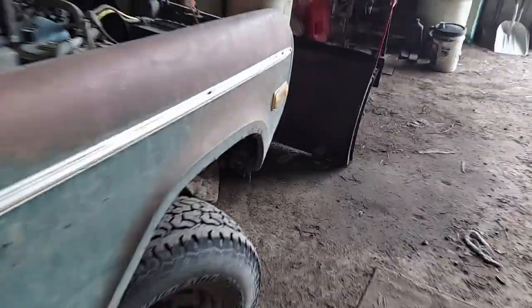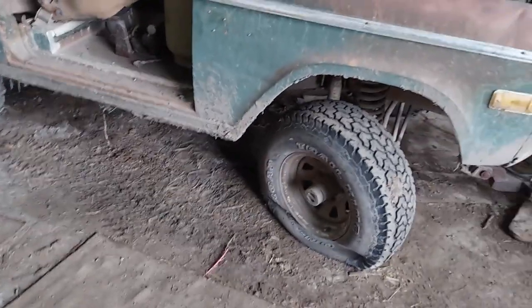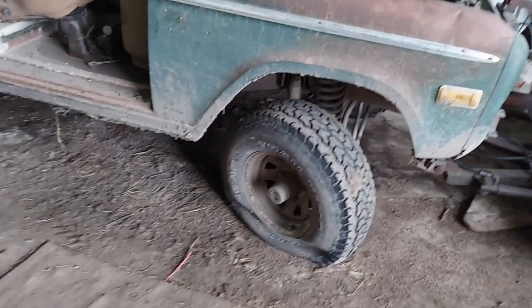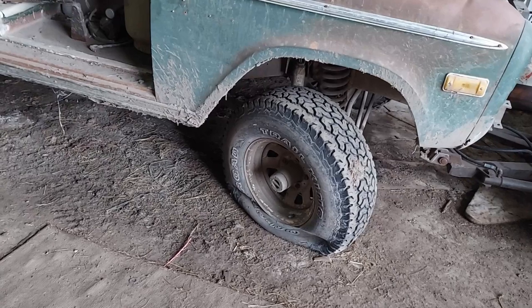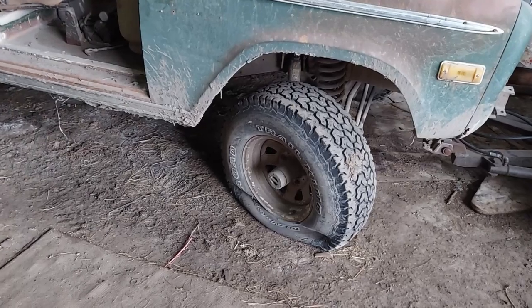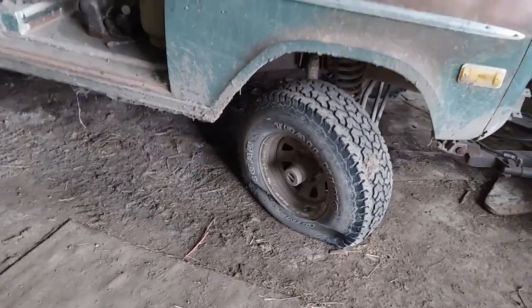I've got my snowplow Bronco here. When I got this thing, all the brakes on it were just shot. And I just had a Chevy 6-bolt axle sitting around. I robbed everything from the steering knuckle out and put on this. For a couple of years, I ran the 6-lug setup, but it just kind of bothered me. I don't know why it would matter around here just for a snowplow, but one day I pulled the hubs off and redrilled them to 5-on-5.5. Honestly, it took longer to take everything off and put it back together than it did to redrill the pattern. So, yeah, you don't need a machine shop to do this.